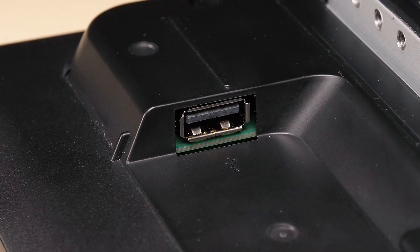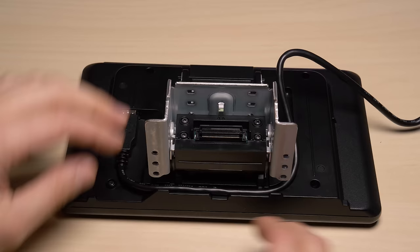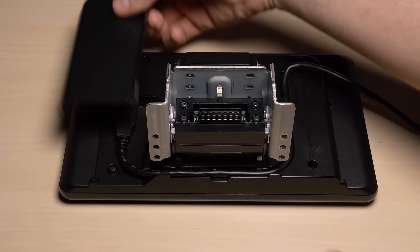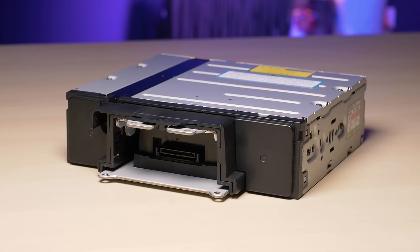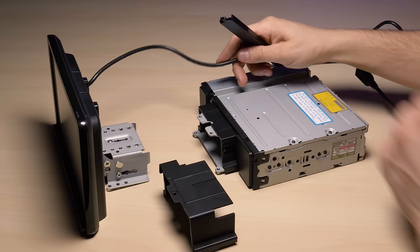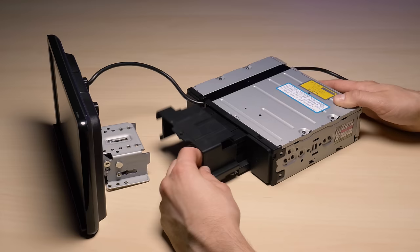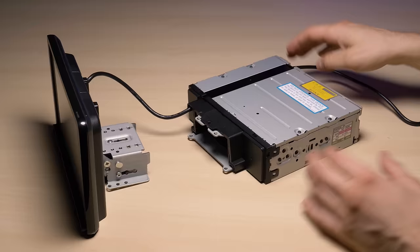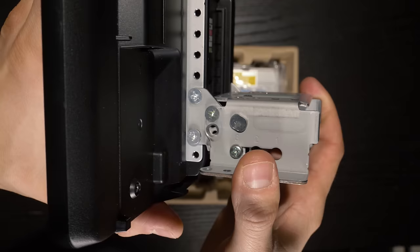The USB input is located in the back of the display, and as you can see, the rear has wire lining. Sony wants you to connect the USB cable, then run it along the wire path on the rear of the display and cover the exposed wire with the rear display covers, ensuring the cable will not break loose. There's also a long black cover along the top of the chassis — gently remove it and you'll find a tunnel for the USB cable. Run the wire to the rear using the tunnel and place the cover back on top. The pieces are a little delicate, so be careful. Sony also gives you the option to just leave the USB dangling behind the display if you don't want to run it behind the dash.